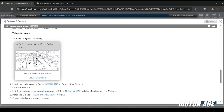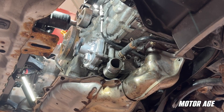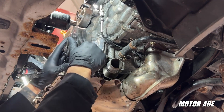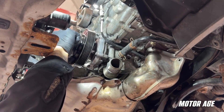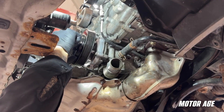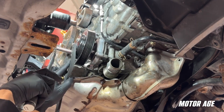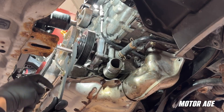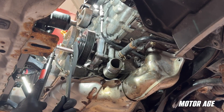For the last step in our pump replacement, we'll go ahead and install the water pump pulley back on — and again, we've got the tightening torque for the pulley bolts listed right here. I've cleaned up the hub of the pump pulley with emery cloth so it fits on nicely without any excessive runout. We'll hold the pulley with our special service tool and tighten these pulley bolts to the specified 14 newton meters.